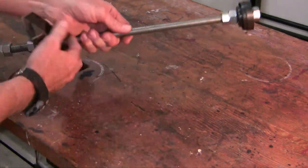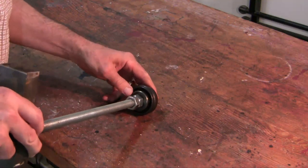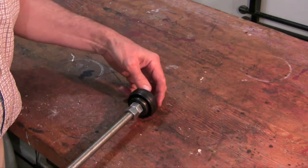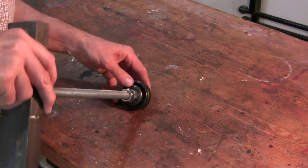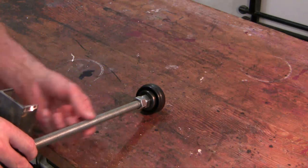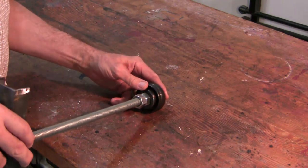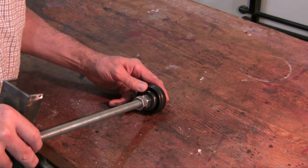Could I make this myself? I think I could — you could make it with a wood lathe or a metal lathe, but I don't have access to one. Could you use a large washer? Well, we did that in the first video — I had a slide hammer and my wife helping and managed to do it successfully, so you may be successful at that. You might also be able to use a threaded rod and drag it into place with some stacked washers, pressing on the outer aspect of the seal to make sure you don't press on the rubber parts. I think if I were to do this again myself, that's the way I would do it.